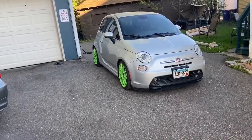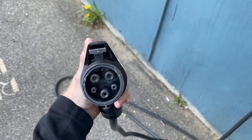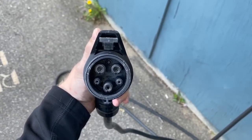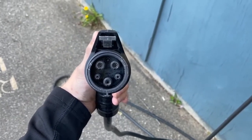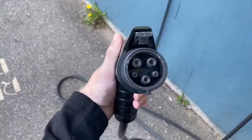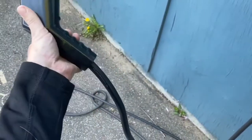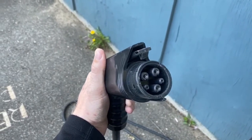This is the industry standard connector here in the United States and Canada. It is called the J1772. What you see at the top are two large L1 and L2 240 volt — or 120 volt for just the L1 — contacts. In the middle at the bottom we have a ground, and then the two little pins are actually a resistive communication method that communicates between the car's charger and the electric vehicle support equipment, like my level 2 mounted charger here. Once you clip one of these into the car, the two little communication ports communicate with the board inside every level 2 charger and it dictates how much power can actually flow through the cord. In this case with this GE unit, it is a 220 volt level 2 30 amp charger.